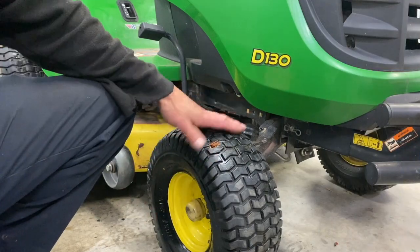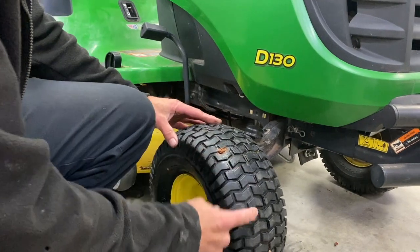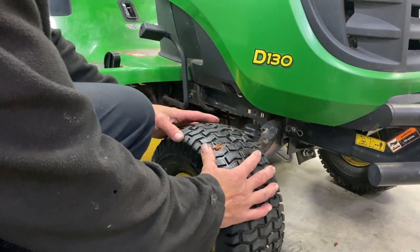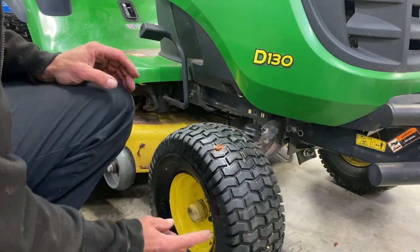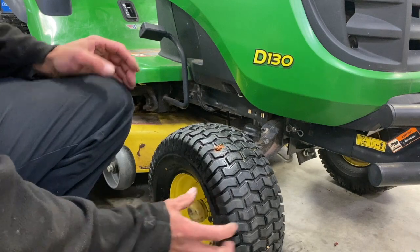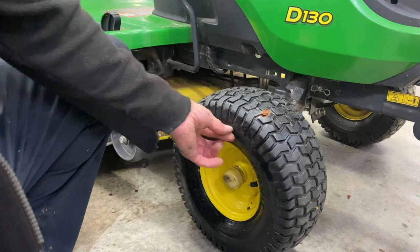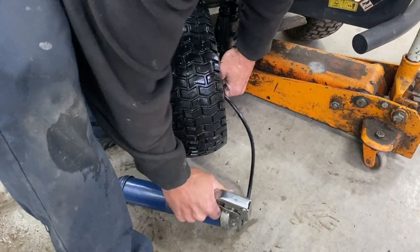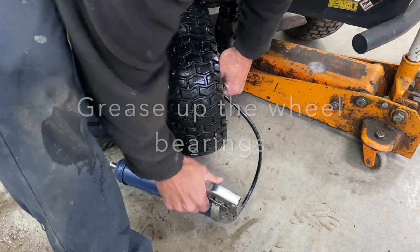You don't have to take the wheel off — you can spray soapy water on the tread to see if you ran over a nail. But if your tread's good, you're going to have to take the wheel off and spray around your rim. If you have a crack and it starts bubbling you can try sealing it, but if not you have to lay it flat. If you have a crack in your tire that's bubbling, you're going to have to put a tube in it. If you like this video, press thumbs up below, subscribe to my channel, thank you for watching.